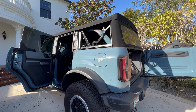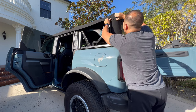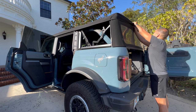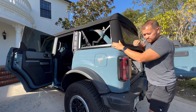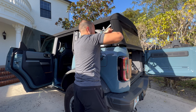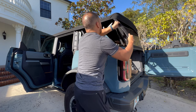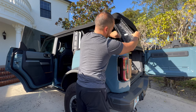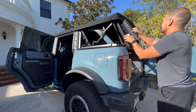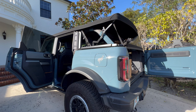Set this down and then peel this back a little bit. Do the clips on the top — I wish I had gone through a car wash before doing this but it was not planned. So we got all those clips out. Just finagle that — there's just a little twisting motion, like that. You can see where this kind of resides in those channels and locks under here. All right, now we got to do it for the other side — it's basically the same process.